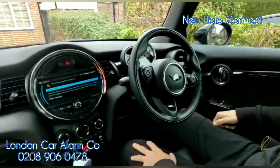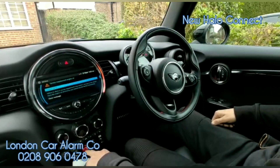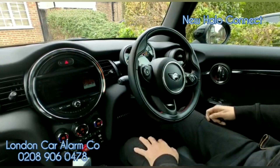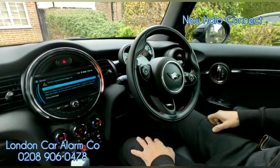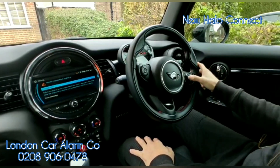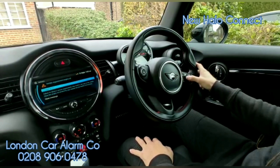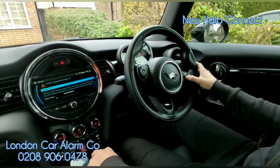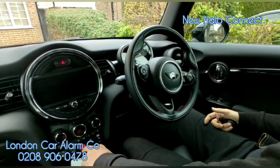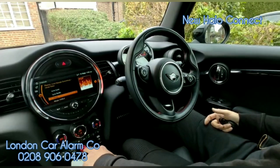When the customer takes the car for a service, simply put it in valet mode. Turn the main ignition on, insert your push sequence, receive the melody, then hit one of the buttons on the network eleven times, and cycle the ignition to get two bleeps. It's now in valet mode so they can move it around — it does not depend upon speed or distance.